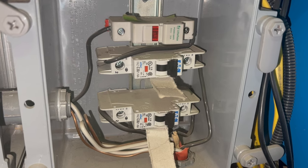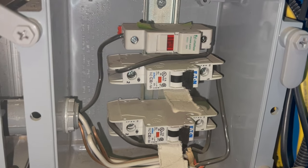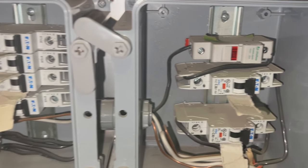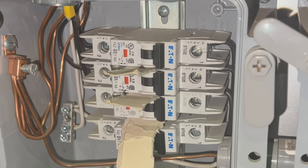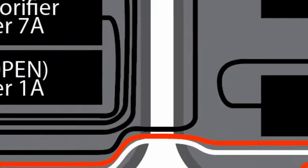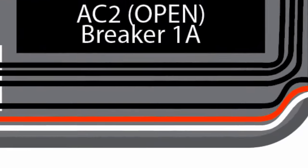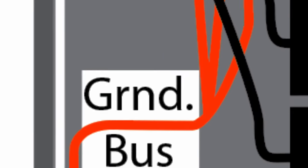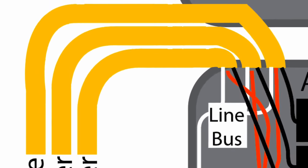Here's how these are wired up. After the AC two power comes out of the inverter and goes through the two fuse and breakers, I send it over into the second box. Each one of the breakers is specifically sized based on the amperage that my instruction manual specified for each particular device. I'm only running the black wire from the AC three-wire cord through each one of those breakers separately — the white and the ground wire bypass those breakers altogether. Then once those wires leave out, they go through Romex to the particular device or outlet they're used for.